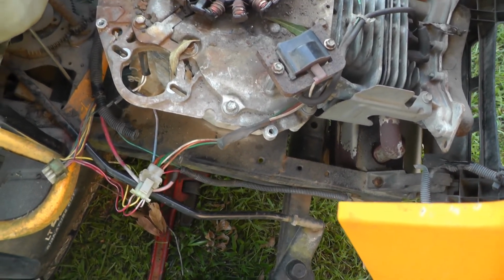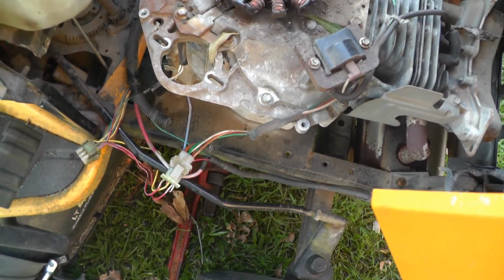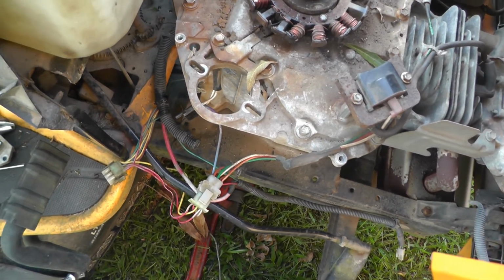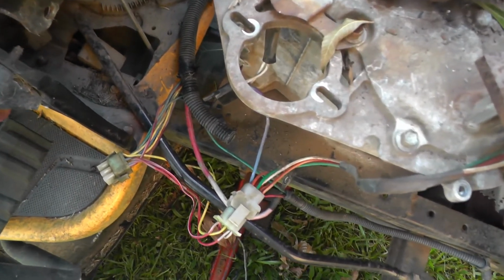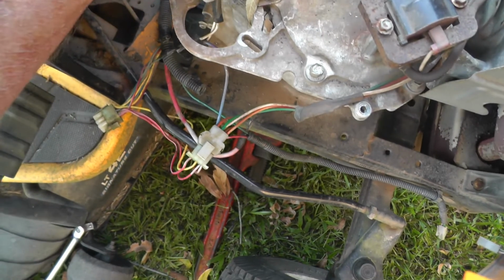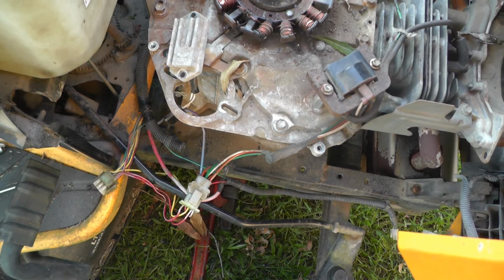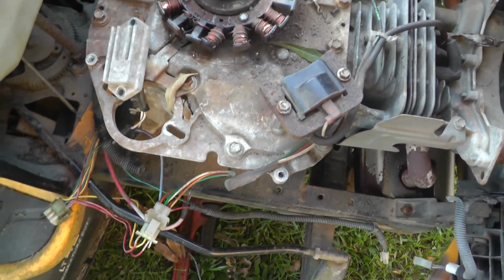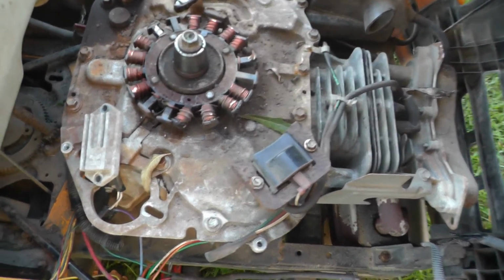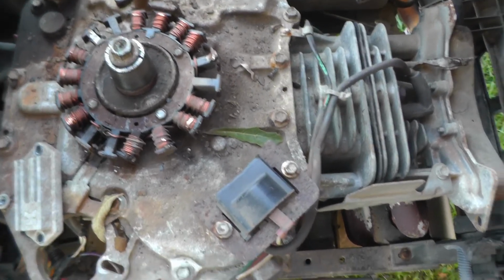And isolating the circuits and undoing the diode. And isolated it until I found the ground. And of course the ground was there on the stator with the magnet stuck to it. And you can see where stuff really got screwed up.